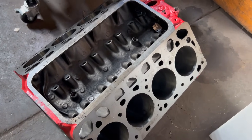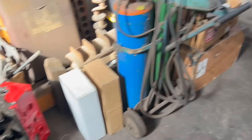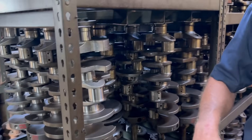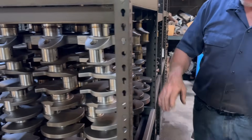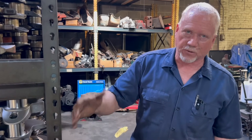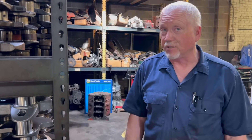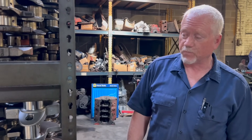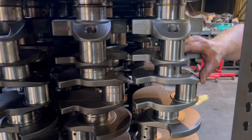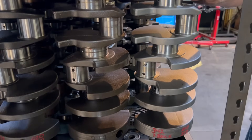Other than a final cleaning, this thing is basically ready to go together — to receive a crankshaft like this. Now this is not yours, but yours will be just like the one over by the grinder. I did cut the mains down to 292 size already, but I left the rod journals stock size and stock stroke for a 312 because we hadn't decided to make yours a stroker yet. So we will do the same thing to this — we'll grind the crank pins down to two inch and offset grind it, so you will have a three-and-five-eighths stroke when you're done.